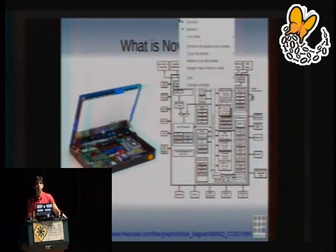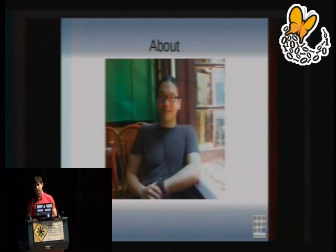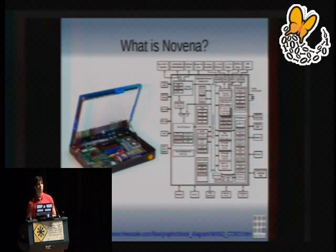To start with, what is Novena? This is the basic block diagram. The Novena is the laptop on the side — I have one up here. It is a quad-core ARM-based, completely open laptop. It boots without any binary blobs. It's what's called a system on a chip, so the one CPU has a whole bunch of different blocks in it: a memory controller, and what a PC would consider the South bridge and North bridge integrated on one CPU.